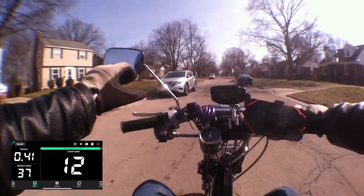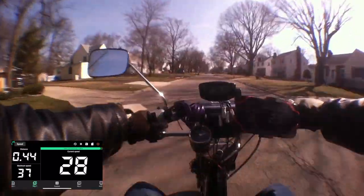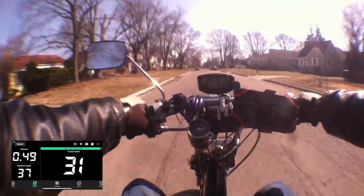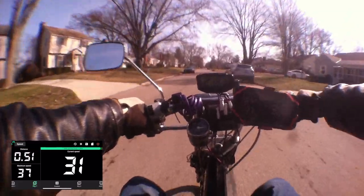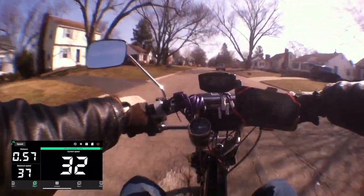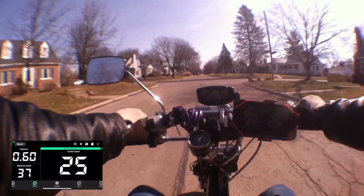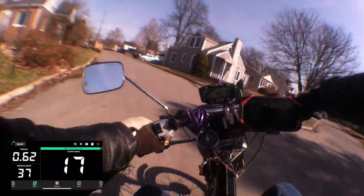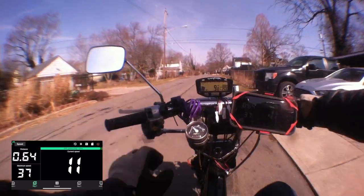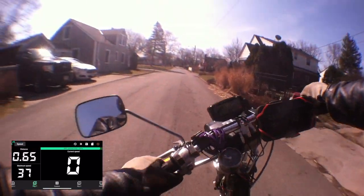And gosh, what main jet am I running? I'm either running a 62.5 or a 65 main jet. And I think the needle clip is on the second richest position. And then the idle jet, man, I don't know. Somewhere around a 20, give or take 2.5. I've forgotten. And as I said, the AX31 belt, and I don't even know how many grams are in the variator anymore. Probably something around 30, 33, I would guess.